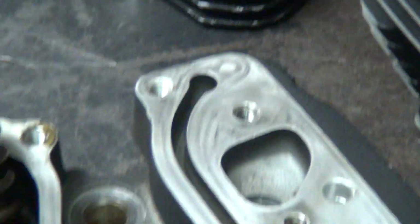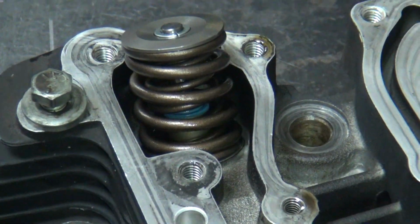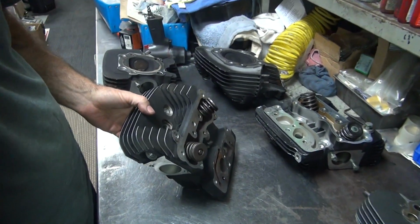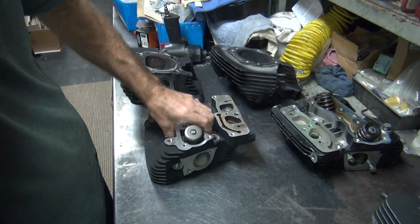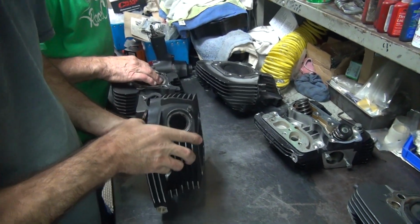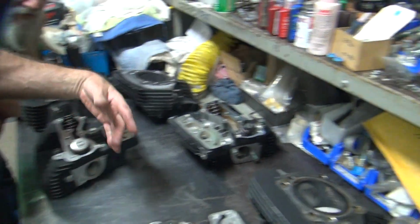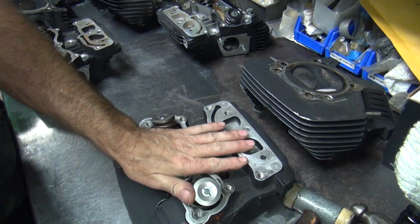Anyway, that's an automotive spring. Harley springs run an interference fit on the coil. See, there's no inner dampener, it's just coil against coil. So these are some kind of performance spring, but we're not sure how much performance. This over here is stock springs, this was the 103, I guess. Another one, that was a 99, I thought. This is smaller bore. This is the crappy port, so it's a 99 to 06 head, or 05. It's stock. This is stock Screamin' Eagle, I'm guessing, and this is stock regular Harley, and this is a 124.